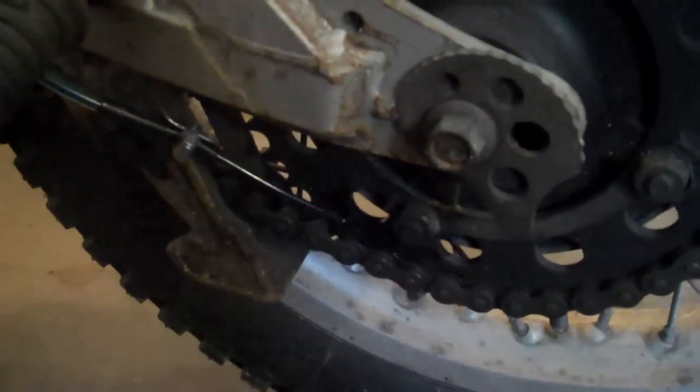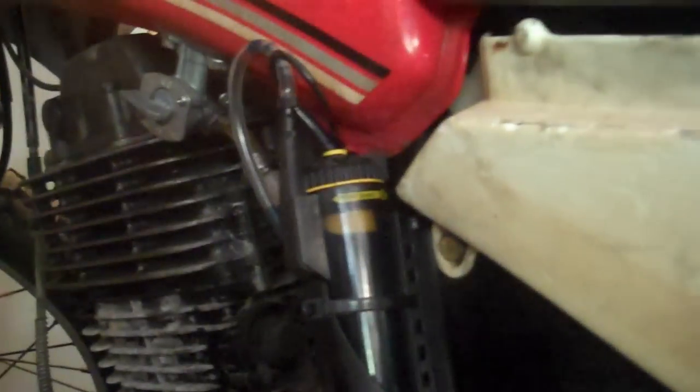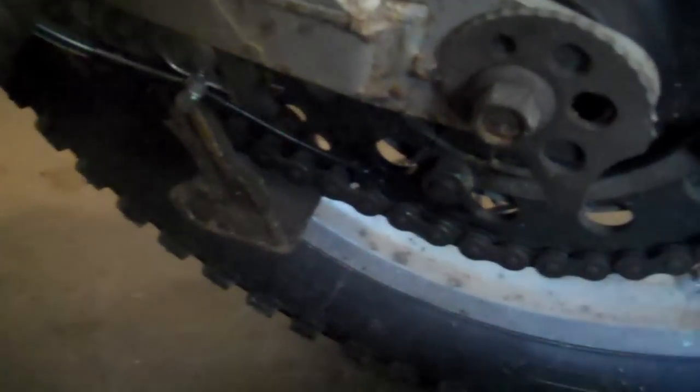It's pretty cool. It's not gonna create a great big mess if you have it dialed properly. If you have it where the flow rate is too fast, then you might get some flinging oil all up in here. But if you have it dialed in properly, you really want to drop like every 30 to 60 seconds. And that's where I have mine set right now. So I'm for them. I think they're pretty cool.